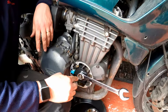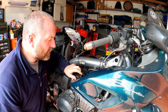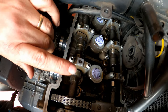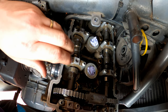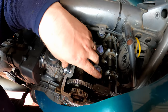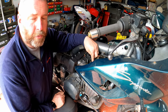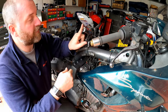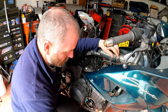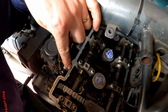I've got a 24mm spanner on the nut on the end of the crank. Now we need to concentrate on what we're going to be doing with the actual cams and valves. The cam lobes on cylinder 3 inlet are actually pointing straight down, so the valves are wide open. The cam lobes on the exhaust on cylinder 3 are closed or almost fully closed. We need to rotate the camshaft so that the cam lobe is diametrically opposing the valve on which it acts - pointing directly opposite the valve.